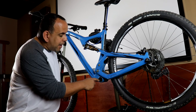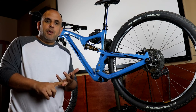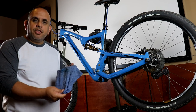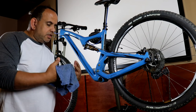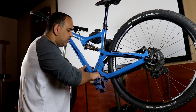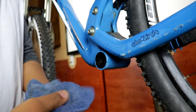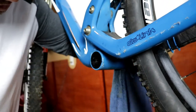We need to make sure the inside of this bottom bracket shell is absolutely spotless clean. The way to do that is rubbing alcohol or some kind of cleaner, a Scotch-Brite or sponge with an abrasive on it that you can really get into the nooks and crannies of the carbon. What I've got here is a washcloth wetted down with some Dawn dish soap to get all the grease and initial dirt out. Let's go ahead and do that — clean the inside out on both sides. Make sure it's spotless.